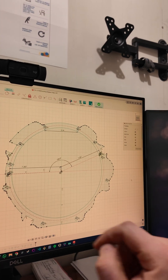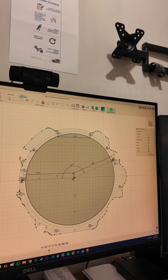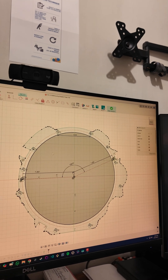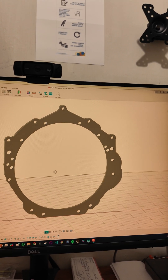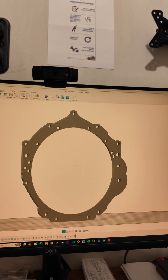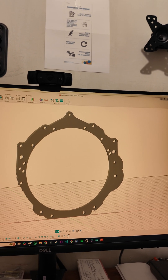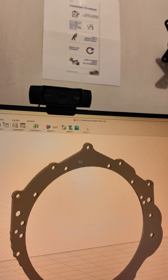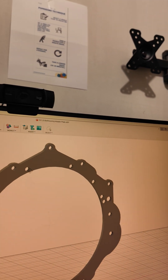Back in the CAD program. I took my measurements off the sheet of drywall and brought them over here. The angle is 158 and a half degrees. Now I've got the Rover pattern and the LS pattern, and I'm going to combine the two into one single adapter plate that can bolt to both sides. Here it is — the two shapes combined into one. We have all of the LS holes and the Rover bell housing holes. For all of the Rover bell housing holes we're going to tap them to M10, and for the LS holes we're going to countersink them so we can use countersunk bolts to bolt into the engine — because otherwise the Rover bell housing will overlap some of those bolts.